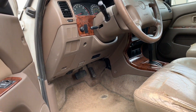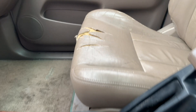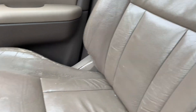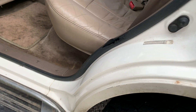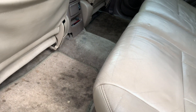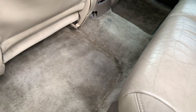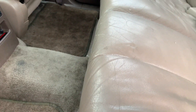Moving to the interior — check your door checks to see whether or not your doors stay open, as those can be costly to replace. In pretty much all these 4Runners, the seats are trash from getting in and out; the leather is of low quality, cracked all over and worn. Moving to the back — look at that weather stripping from getting kids in and out with car seats. No rust on the rear panel, but it's pretty dirty. Those floor mats are going directly into the trash — it's an indication it probably wasn't taken care of all that great.